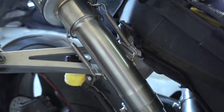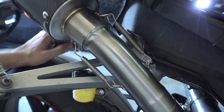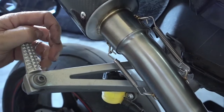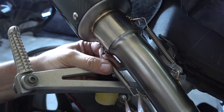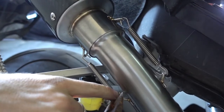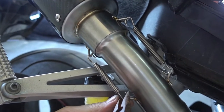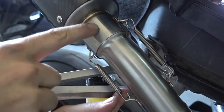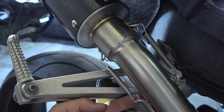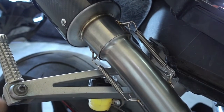But there's one thing now, because later I still want to show you our MK2 and the Titanium. So I want to change the mufflers later again to show you the other models. If I wouldn't do this, then there's one important detail. You should take your pliers and squeeze these hooks together. This prevents them from coming loose. So you squeeze them closed. I don't do this because I still want to change the mufflers for my pictures later. But if you're really going to ride and you want to keep them on the bike, use your pliers and close these hooks. It's really important.